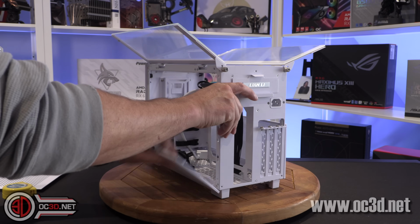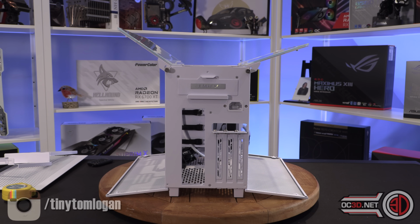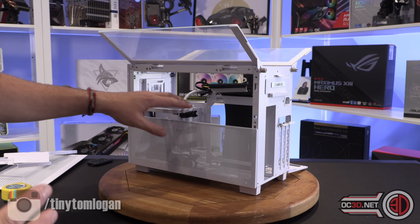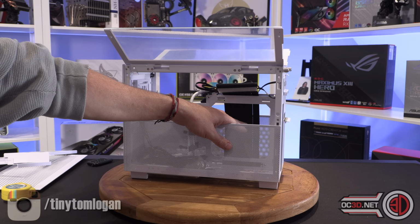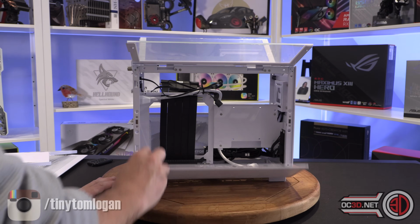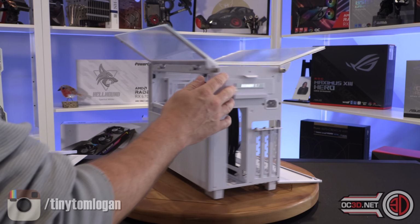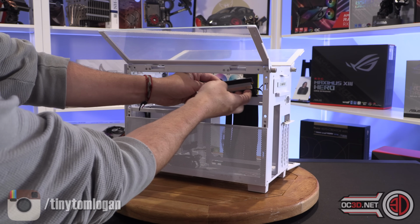And then also, while we're here, with the Batman gull wing doors, I think it's actually kind of cool, the bottom all opens up like it as well. Now I love this. So you've got a little viewing panel, for want of a better term, at the top, and then you've got vents there. Now the vents at the bottom are for the fact that you might have a CPU cooler in this side, because this is where the motherboard should be, and then in this side, this is where the graphics card is. And if you have a look, you can see that this is your riser cable. It comes up, goes through the little flap, and then it would go around the other side, and then you would have it plugged into your motherboard.